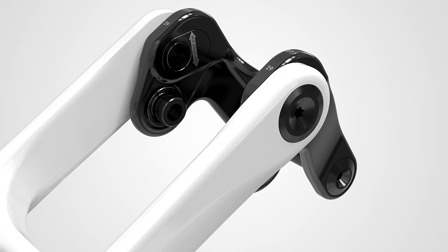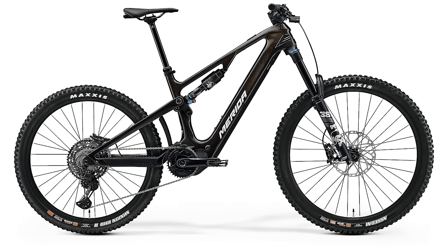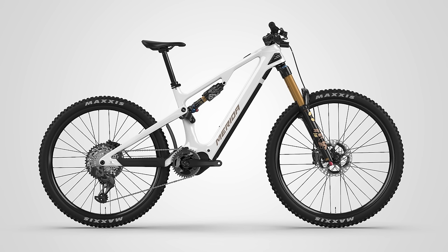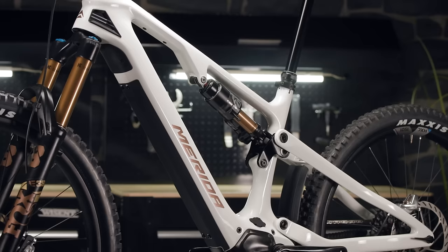You've got three new bikes sharing the same platform — a 170 carbon and a 170 aluminium. The bike here is the e160 CF, the carbon fibre bike — obviously more expensive but a lot lighter. It uses a 600 watt-hour non-user-removable battery, though you can remove it for service. It's also boosted — there's a 360 watt-hour range extender which is removable, so the bike uses the range extender first. You could finish that off, pop it back in your car, and continue.